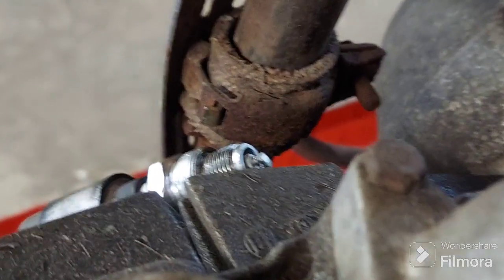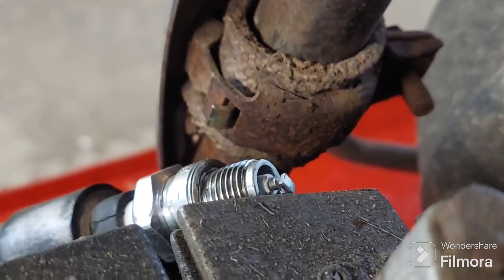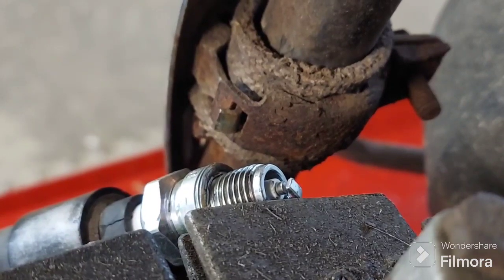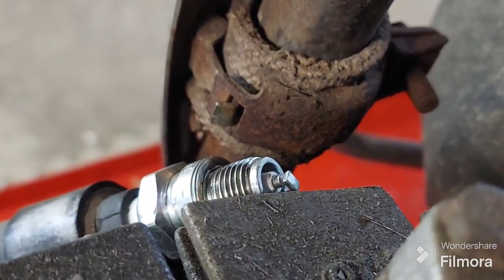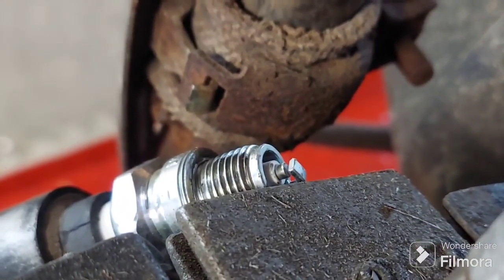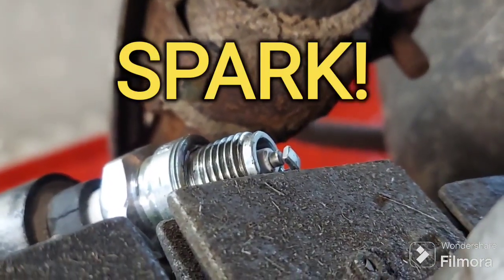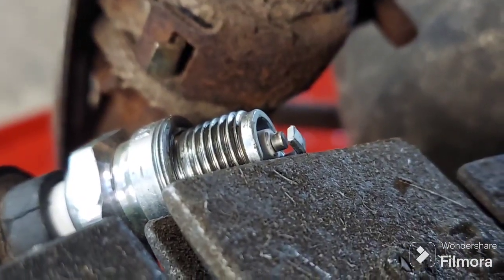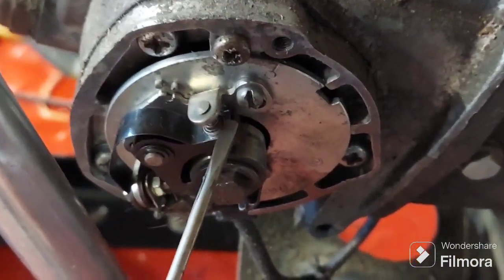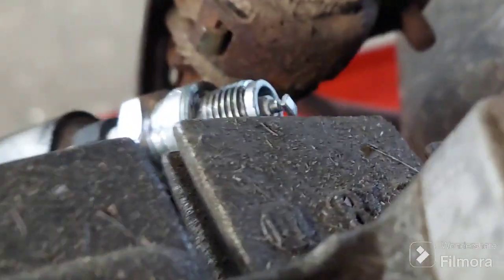But wait, there's more. Let me turn the light off — you guys watch that spark plug. What I'm doing is coming right here to the point and just breaking the points open with a screwdriver. And that's what causes the spark — you can see it. So the ignition system itself works.